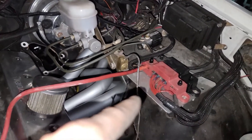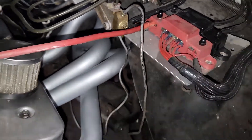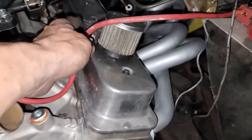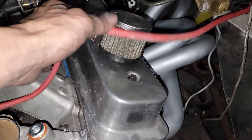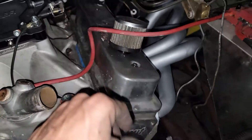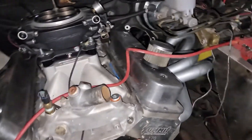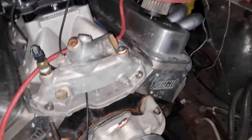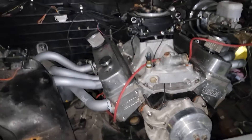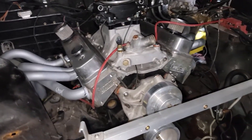I made another positive cable that's on the starter and comes up, goes past the alternator to the distribution block that has all the power wires. Once the alternator is in place, I have a ton of extra cable here — I'll cut it, put the ends on it, and tie it onto the alternator. That gives me a bigger cable going to the distribution block and a nice big cable going down to the starter.